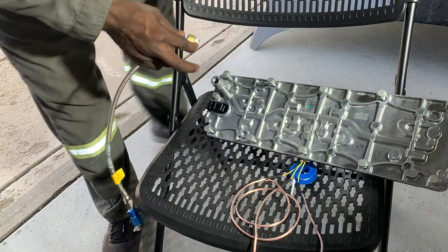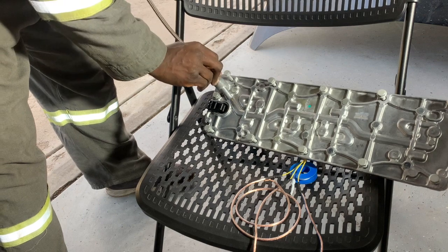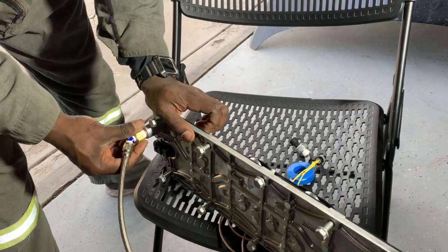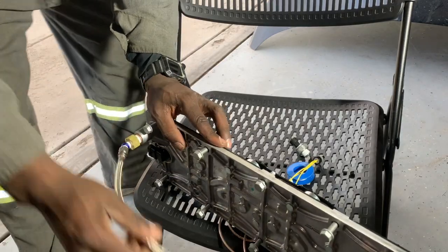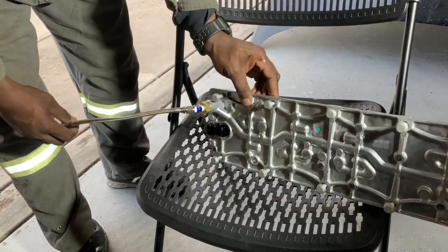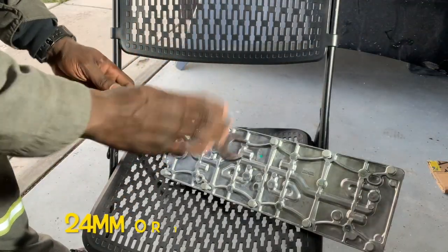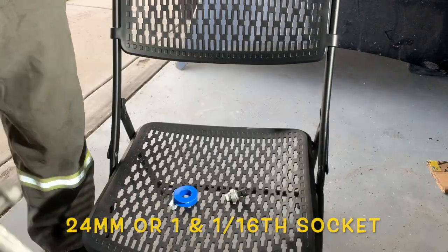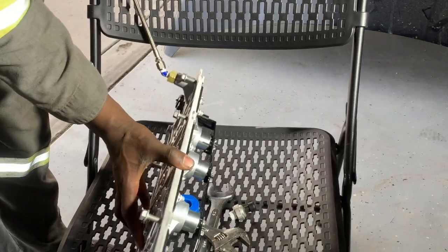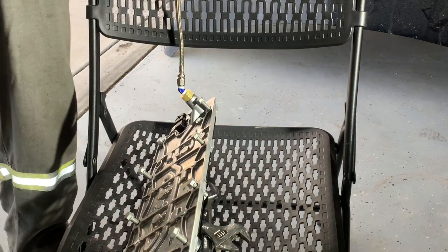Every time I've changed the filter these last couple of times, the filters have been fine — it's just giving me the sensor issue. My bigger question is why does it continue to give me the sensor issue? Maybe me breaking this was a blessing in disguise, because maybe it's this manifold that needs to be changed anyway. I'm going to go ahead and tighten her — with the equivalent of 25 foot-pounds. Now that I've got this tightened, I'll use a crescent and put the sending unit on. Got the plumber's tape on there as well.